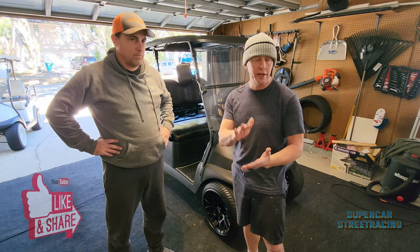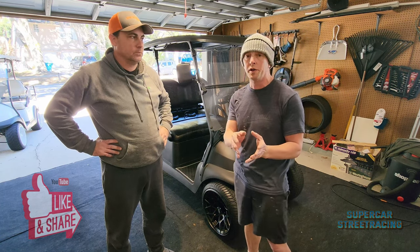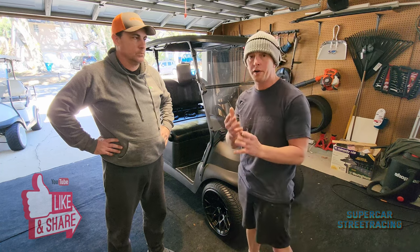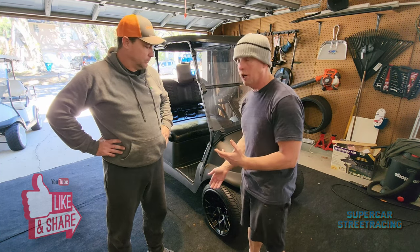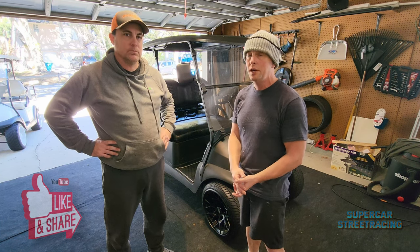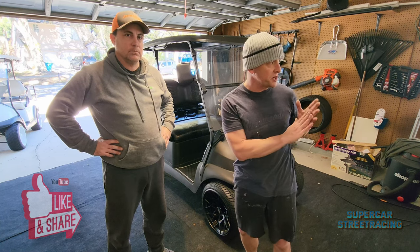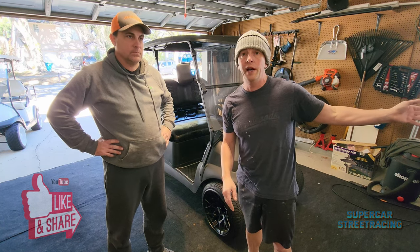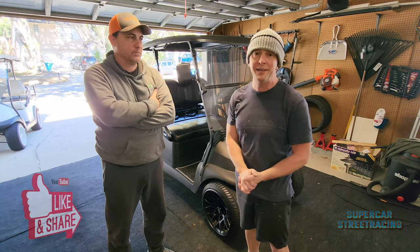We got everything painted, we got everything clean. I would say if you want to do this project yourself, if you really want to go crazy, you can order mostly the whole new subframe and replace all the parts. You can replace your hubs if you think you might have some miles on them. If you don't, you can get by with what we did, which is all brand new bushings, and we cleaned up everything on the wire wheel. We degreased everything with some brake cleaner, and then we put everything back together.